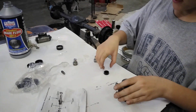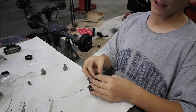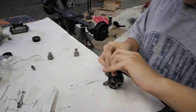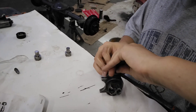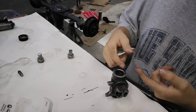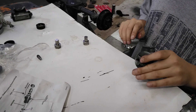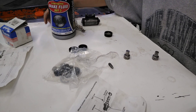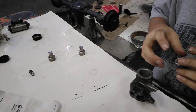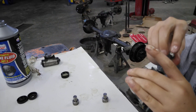Okay, so now the bore should be ready to slide this cap in. These caps are really tight in here, so you gotta start in a corner and then kind of push it in, push the rest. It's kind of a hard process with these. And then I go until the cap is flush with the end of this. Next, you slide in the spring. Here it is. So you slide in the spring and you gotta make sure that the spring seats inside of that seal that we just put in.